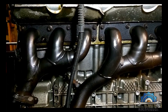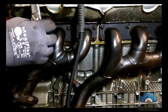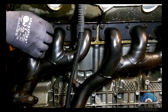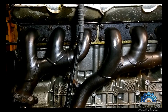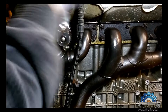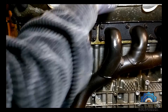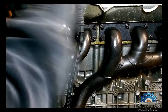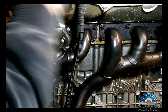Maybe they're coming off so nicely because I sprayed the whole engine with penetration fluid beforehand — quite a lot of it. So that's recommended: use penetration fluid before doing this job, or any job where you think there might be a problem. That's probably the reason they're coming off so easily.